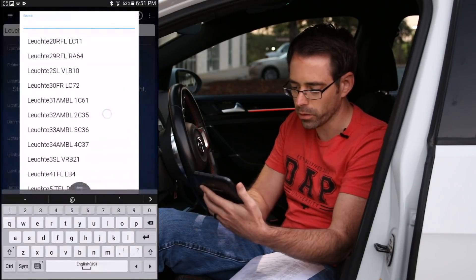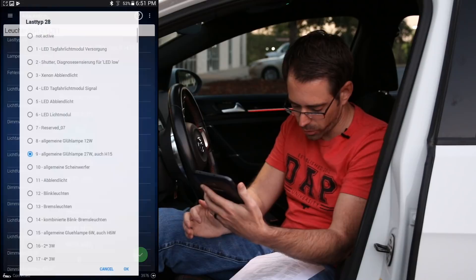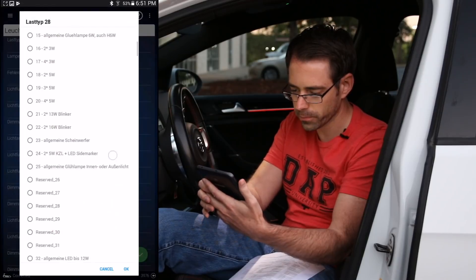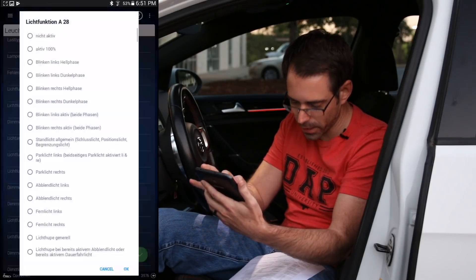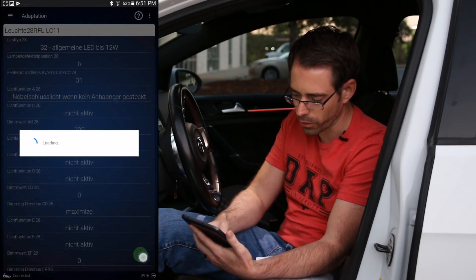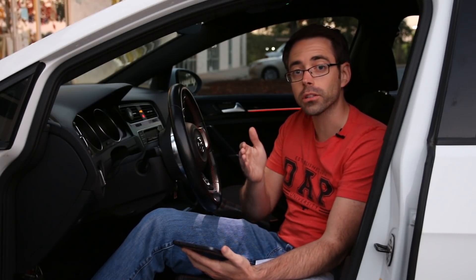Last, we're going to channel 28. The top value we're going to change from 9 to 32. Then A28 — that's changing what is a reverse light and making it a rear fog. That's accepted and our coding is completed. We can test our taillights. Thank you for watching our Mark 7 taillight harness coding — purchases for parts like this help support videos like this one. If you like this video, give it a thumbs up and subscribe.